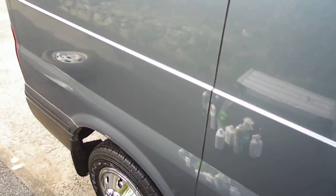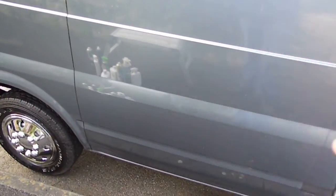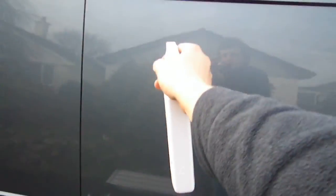For an ordinary wash, get an Autoglym Aero Wax. Get the vehicle all wet, shampoo and wash it all off, get your chamois and wipe it so the water is pretty much gone — 95% gone, about 5% left on it. Then for each panel — about two or three feet — just do about three or four sprays. Get a microfiber cloth and work that in with the water over the bodywork. Leave it for a couple of minutes, then use another clean cloth to buff it off.